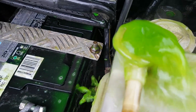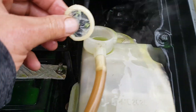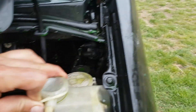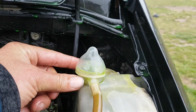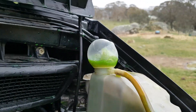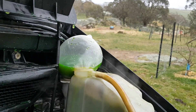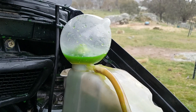So I'm going to do my condom test. There's a test where you can put the condom on, and then it inflates just because there's so much gas from the head gasket. Do you reckon the head is gone? I think it is.